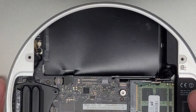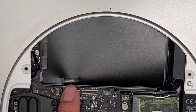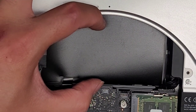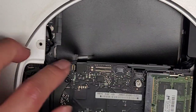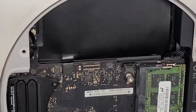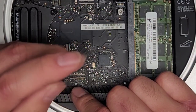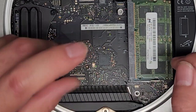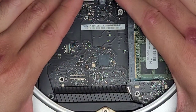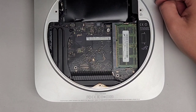Let's go ahead now and get to the next parts of this repair. Here you can see there's the hard drive connector. This model actually has a second spot for a hard drive — that's what this connector is. You can actually put a second hard drive on top of this, but you would need the cable. We're almost done — we're going to have to remove one more screw. We're going to remove this one screw down here as well.